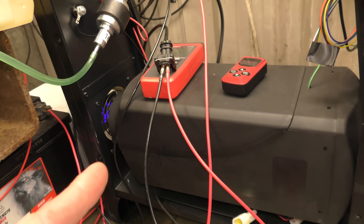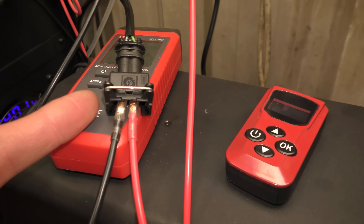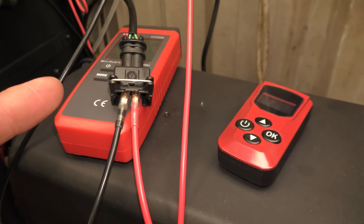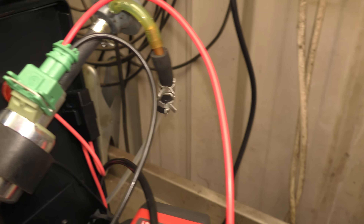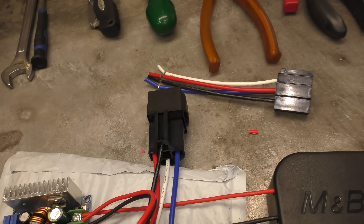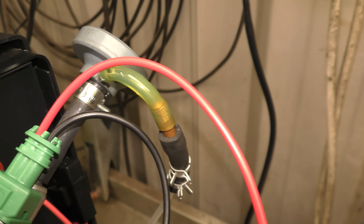This runs on these rather long wires — if you were doing this properly and making a nice install you'd have nice short wires. This is the fuel pump connector wire that comes straight off the ECU, and we've got two wires in it that are unnecessarily long, but we're just using it for testing. The black wire comes out, does a loop, goes straight back into the pump — straight off the ECU into the pump. The red one travels back down, connects into one side of the wiring loom of the 24 volt relay, then comes back out the other side and goes back up into the pump.